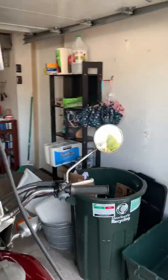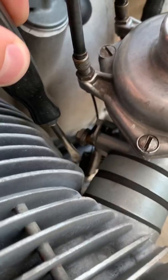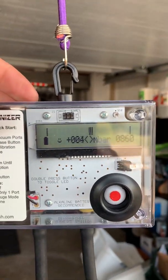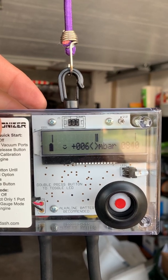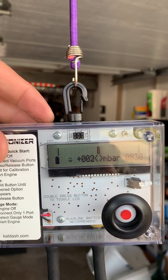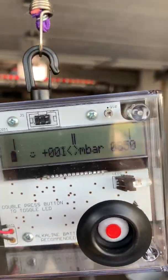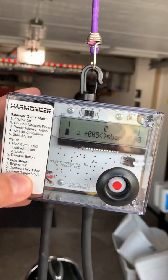Now if I wasn't okay with that, just on the back side of my throttle return spring is my screw — the idle adjustment. You'll adjust both sides until you reach your happy medium. I found that with mine, as I adjusted one carburetor over the other, my bar would move more on one side over the other. So I just adjusted it until I got my bar in the middle, then I would adjust both until my RPMs were right where I wanted them. A good way to know if your bar is where you want it to be is after every little adjustment you make, just give your throttle a little drop, let your carburetor settle, then find out where you're at.